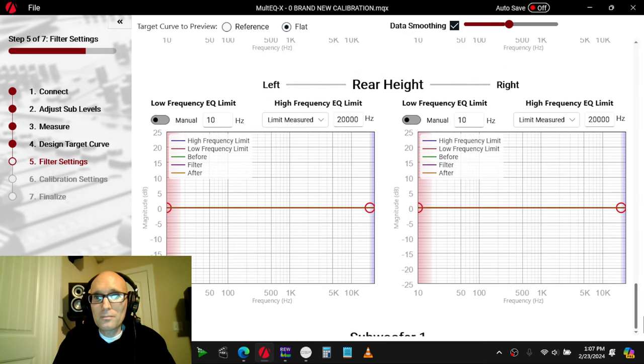Now, one thing I've been thinking about as well is what is important to you and what should you chase? So if you align phase at cursor here at 70 hertz, you are leaning now towards this side of the response, right? John, the maker of REW, has, I don't know if these are new tooltips, but I don't think I had them before. It's one octave either way, right? So if you pick 50, that will be up to 100 hertz and 25. So that's a pretty good place, I think, for everybody to do. And the reason is because the phase traces, look, down here, past 20 hertz, it gets relatively ugly anyway, right? I would never optimize for this because, well, one, you don't hear it.